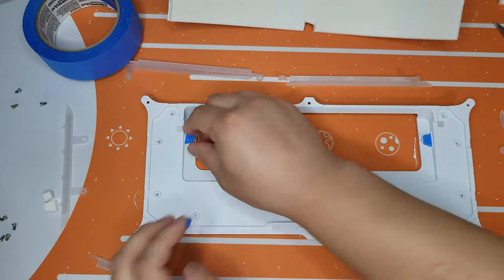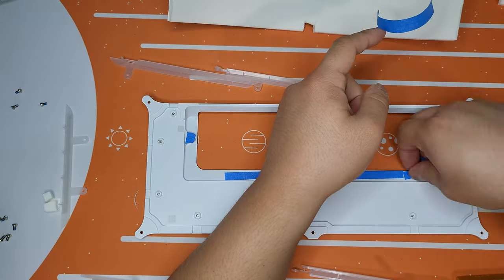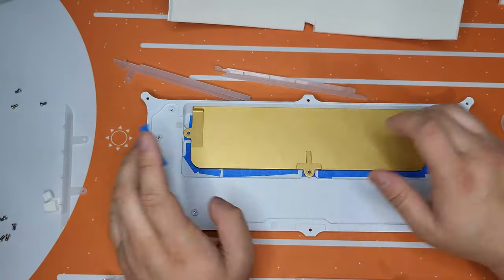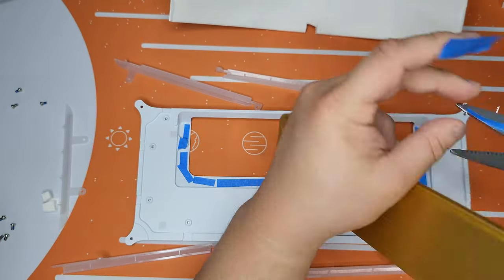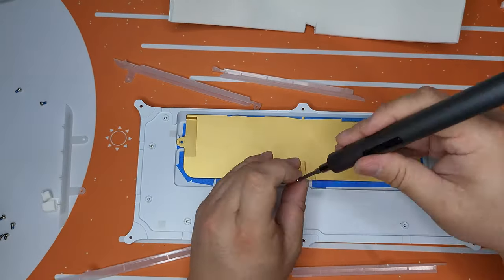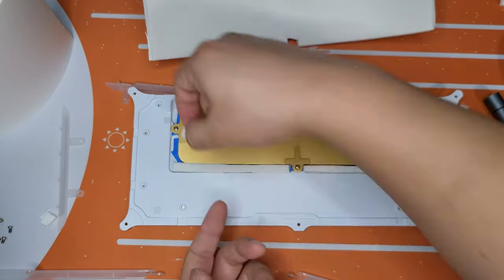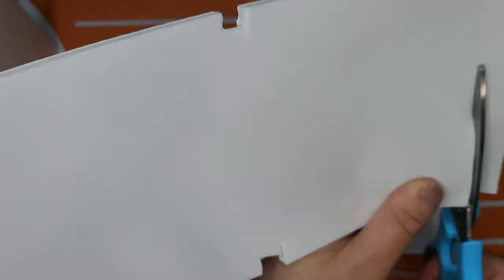The first thing I did was put painter's tape on every single surface that touches the metal, especially where the metal plate is sitting. One of the best ways to reduce metal rattle is to cover up the surfaces so that metallic materials don't create pinging. I covered up the whole area where the weight plate was sitting. This already improved the fitment of the keyboard — no more plate rattle at least. Then it's time for the foams. I started cutting up high-density memory foam to fill up the empty spaces.